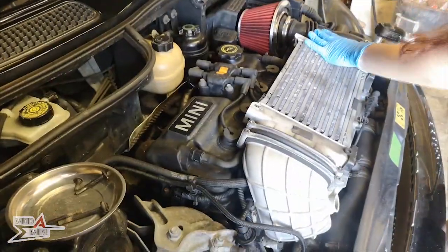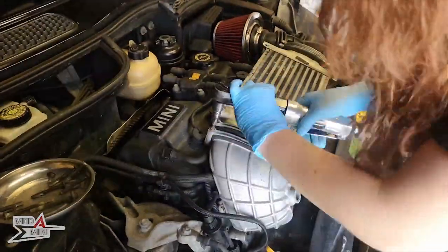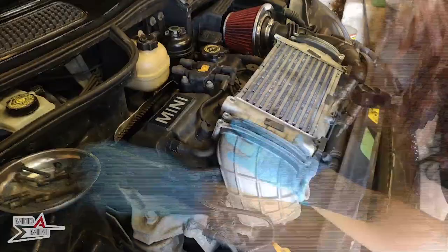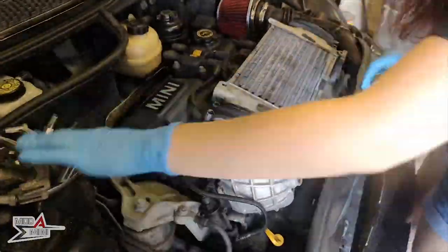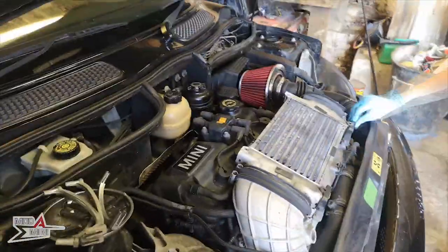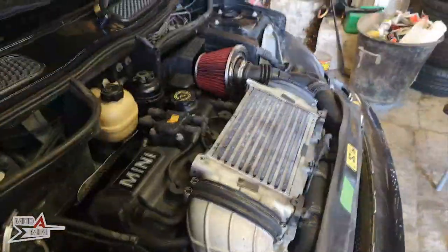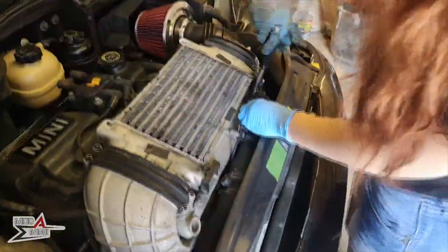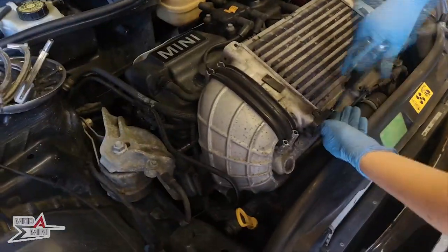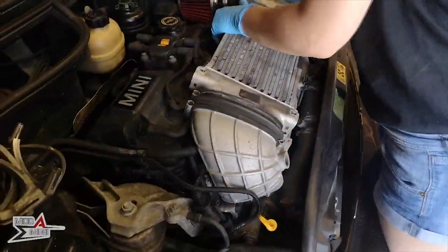I am saying this like I'm pretending it did not happen to me. Loosen the two clamps at the front of the intercooler once those four side ones are off. I've removed them completely because I will be taking a lot more of the engine out, but if you are just taking off the intercooler you can just loosen and pull them to the side. Everything on this car is pretty filthy - but once the intercooler was off I can see that it is filthy on the outside and on the inside. Because I will not be putting this back on the car for the foreseeable future, I've sprayed engine degreaser over and through it to clean it up. If you will be putting yours back on sooner, you will need to make sure that everything is thoroughly dry first.